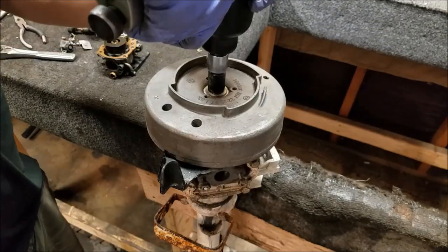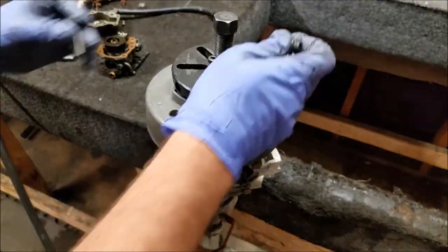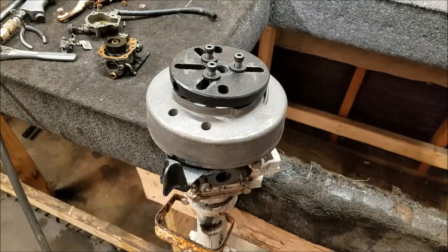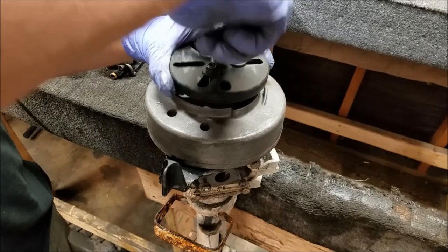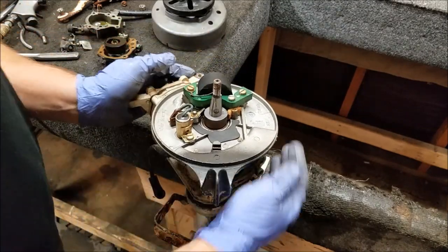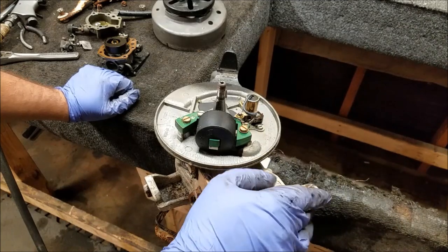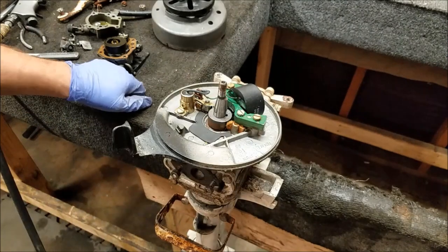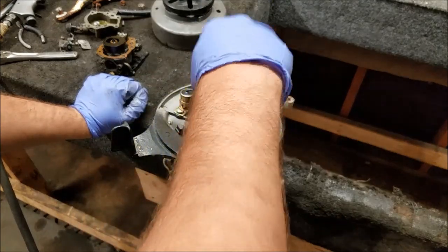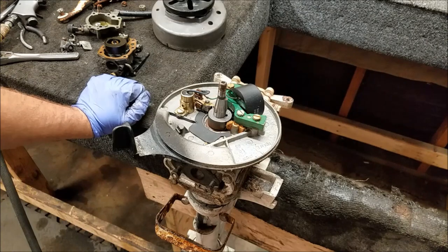Let's add to the mess on my bench here. I'm going to pull this flywheel off and see what our coil looks like. That coil looks perfectly fine. The wire needs to get changed, don't get me wrong, but that's a pretty good looking coil — that thing looks brand new. Honestly everything under here does, which is a little scary. Why did this thing wind up in my junkyard? Maybe somebody had some problems with it but replaced the coil and ignition points hoping it would run better, and it didn't, so they junked it.